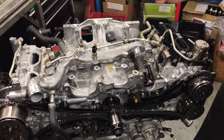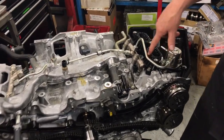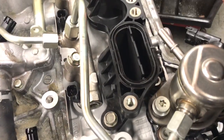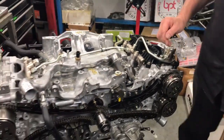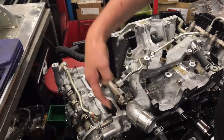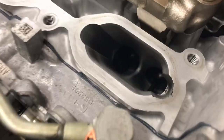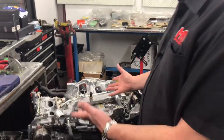One of the things I wanted to talk about now — you'll notice I've left this side on because we haven't put the inlet manifold on yet. This is the riser that connects to the inlet manifold, and you can see it's got a split design, almost like the early model Subaru EJ series which had a variable control butterfly for the TGV or tumble generator valve. But on the FA series engines we've left that off. You'll notice this part here is actually removable — it's an insert that goes into the machined part of the aluminium housing on the intake of the engine itself. And if you look carefully you can see right down inside there the backside of the valves, which then lead into the combustion chambers.